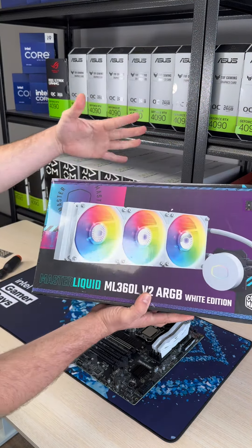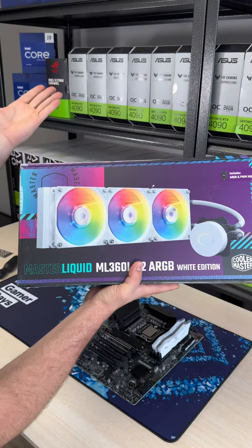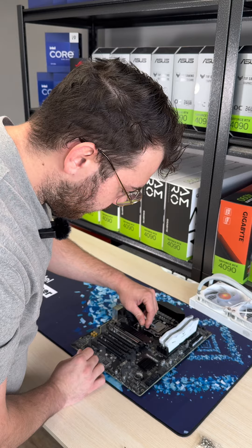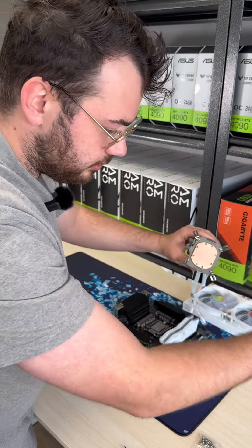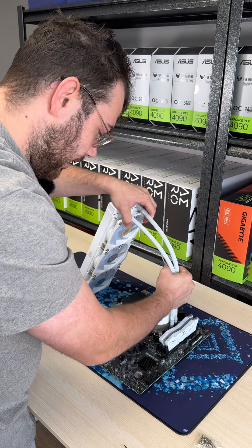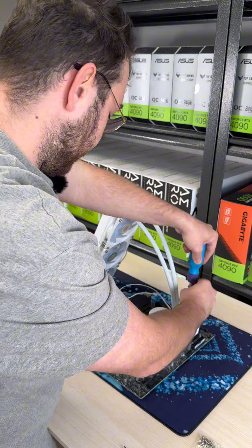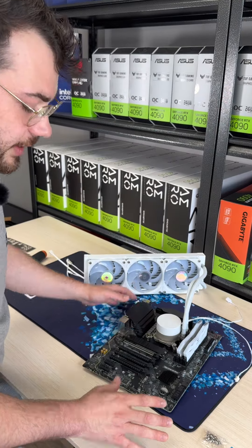Now that we got all of that out of the way, the next thing is to move on to the cooler. For this, we're using a Cooler Master 360mm AIO in white — it's an amazing cooler. The price is right and they do a phenomenal job at cooling. Now that we've got everything ready, let's add some thermal paste. I usually like to do a little X pattern; if not, you could just leave one little dot in the middle and that should be adequate. Don't forget to take off the peel. Let's add this cooler down, and perfect — it's on. Now we'll screw that AIO securely in place, doing one corner at a time. So now that we got the CPU on, the cooler on, the RAM and SSD, the motherboard is finally complete and now it's time to move on to the case.